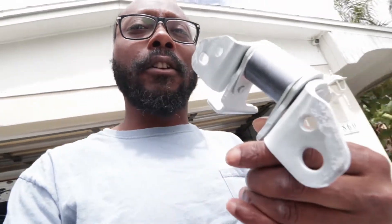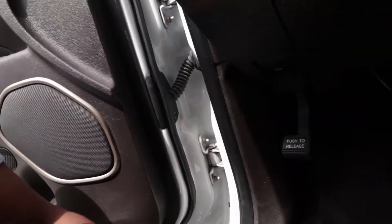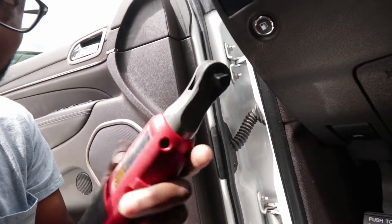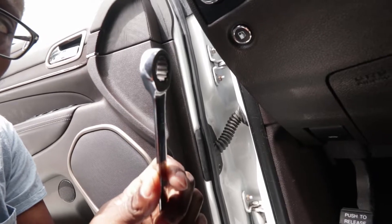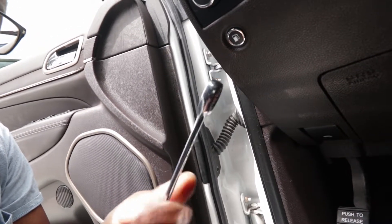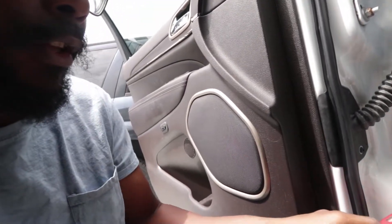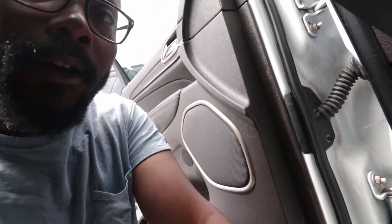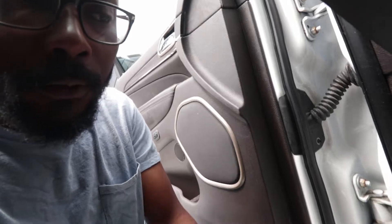So you're going to need this part — I'll put the part number in the description. You're going to need a couple of tools: a ratchet, 13 millimeter. If you're fancy, get yourself the speedy Milwaukee. Probably more preferable would be one of these ratcheting box-end wrenches — these are real nice because they fit in tight spaces. You can fit a ratchet in there too, it's just a little tight. Bottom line, you're going to need a 13 millimeter wrench of some type. It doesn't really matter what you use.